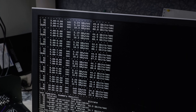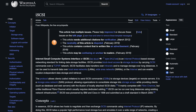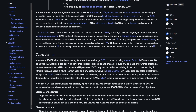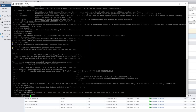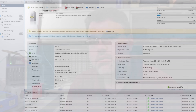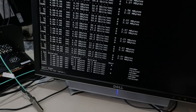As for software, that's up to you — it's a whole universe of possibilities. If you haven't learned about iSCSI, let me introduce you. If you have software on a storage device like this with iSCSI enabled, every built-in version of Windows for the last decade pretty much has a built-in iSCSI initiator. So if you go into Control Panel and connect to this thing with iSCSI after creating a volume, you can have a volume that only one computer can attach to at a time over the network, but it's treated exactly the same as a local hard disk. You can install games or anything like that and have them running over the network, but it's not actually a local hard drive — it runs over the network.